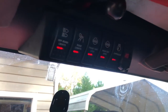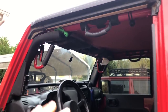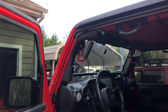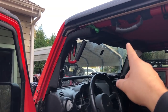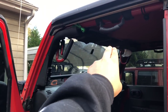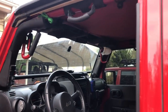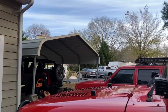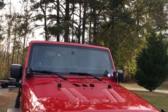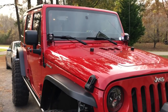If you watched the video I posted the other day, the S-Tech switches are doing great — hasn't killed my battery yet. But I talked to the owner Scott, and he said if you do want to run it so the power is always on but you don't want those lights to come on, you simply cut the blue wire and tap it into your headlights. So whenever your headlights are on and the Jeep is running, those lights will illuminate, but whenever you turn the Jeep off, the switches will still work but the lights won't be on. That discount code — 20% off using JKGG20 — will be active for a long time. So check out their products, and if you need a switch pod, hit them up.